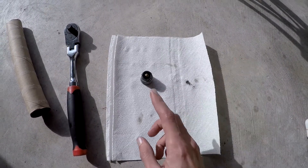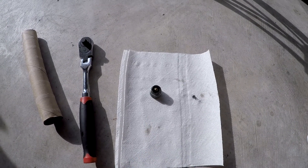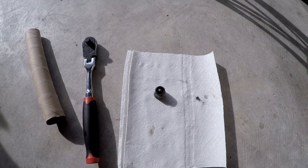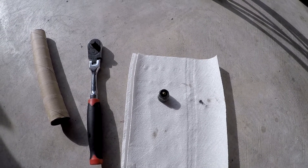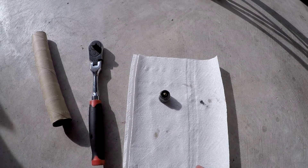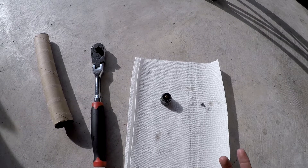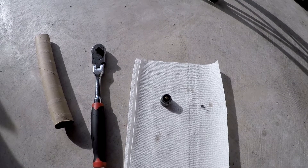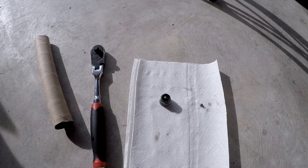This one's a little bit more dirty. I'm going to get it cleaned up. Whenever you put the bottom one in, you're going to torque it to 36 pounds, and then put in your 0.8 quarts. Basically you keep putting fluid in until it starts overflowing out of the top bolt. Once the top bolt has a little bit of flow coming out of it, basically just put that one in and torque it to 36 pounds as well.